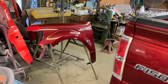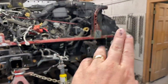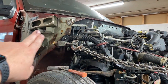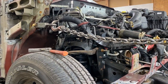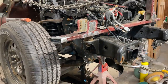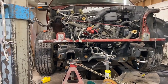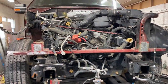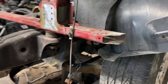You can see one of my fenders there. Coming over here to my truck, Jack has already begun setting in his bottom plate, which is prepped and almost ready. He'll have to do a little reshaping on the top part, but on this section he can just cut the spot welds out, that'll come out and the new one can slot right in. Now this corner is where Jack's frame shop magic and experience comes into play, because my donor truck had been wrecked and rebuilt once before. The previous shop really didn't do a great job — this corner was all jacked up. But Jack was able to rebuild that corner and it looks basically like the factory one.